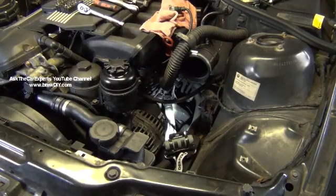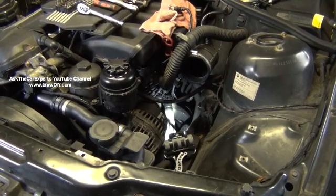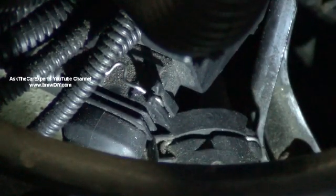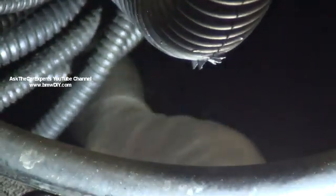With the airbox out, you need to reach down and get the wire end that goes to the harness for that camshaft sensor — let me zoom in on that. It's right below the intake, and it plugs right into a box which is all part of the harness. There's a tab that you press down on to release it.